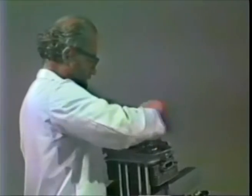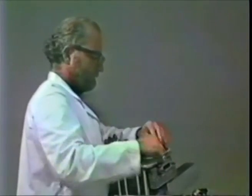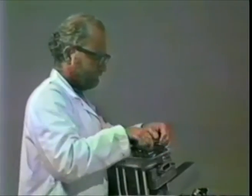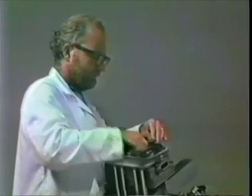So we tighten these down. We'll do both sides and we'll run through with the torque wrench at about 15 foot-pounds on all of these nuts. Get this one down here. You can, by cranking the engine over, get all the valves on one side so none of them are open or beginning to open. And that way you can torque all these down without fear of having to torque also the valve spring, which can really be a chore to do. So you get them all snug.